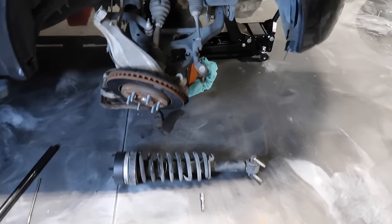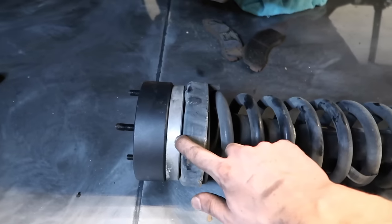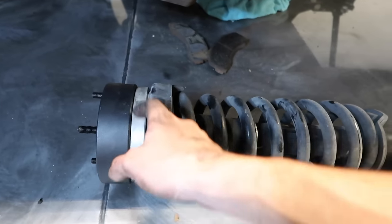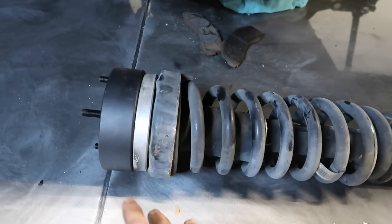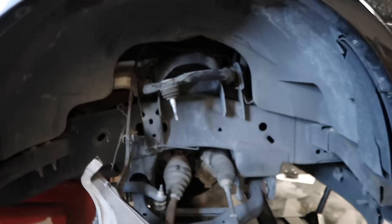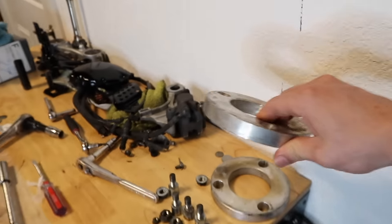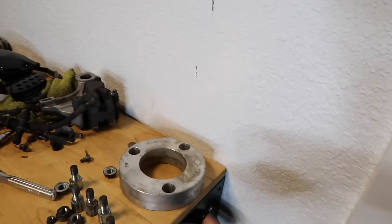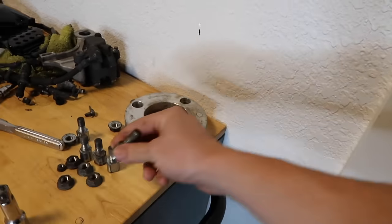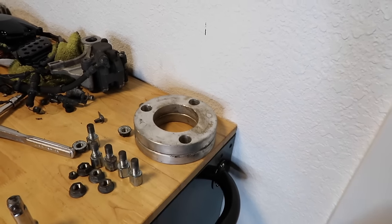We got our puck on, but when I got in there I saw it already had one. I don't know if that's because of the tow package, but you can't remove it because the nuts are different. Either way I measured it — it had two and a half inches of rake and that is a two and a half inch puck, so we just put it on. I was so wrong about leaving those in. The truck sat way higher in the front and I ended up having to take the whole thing apart and remove those extra studs underneath.